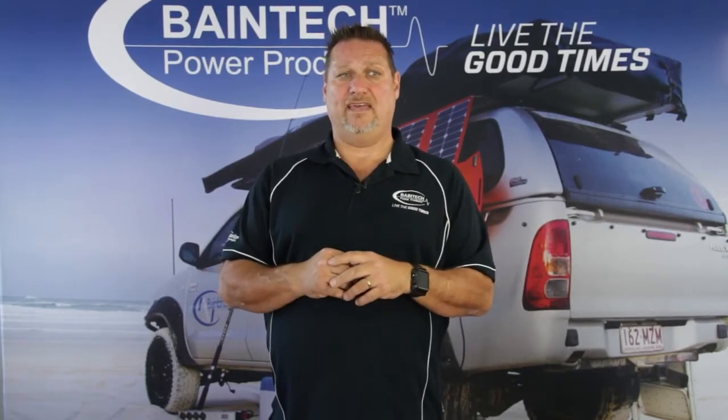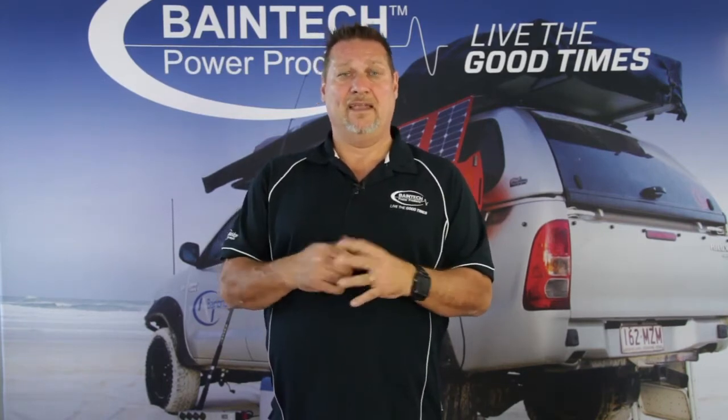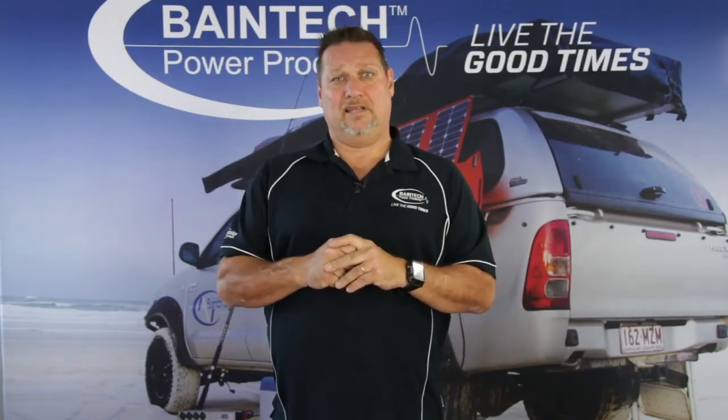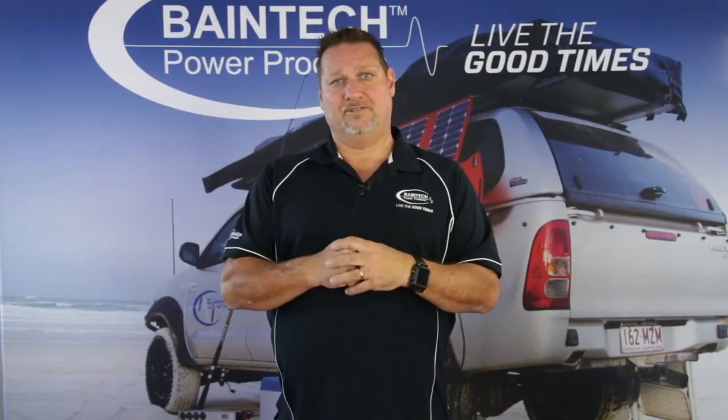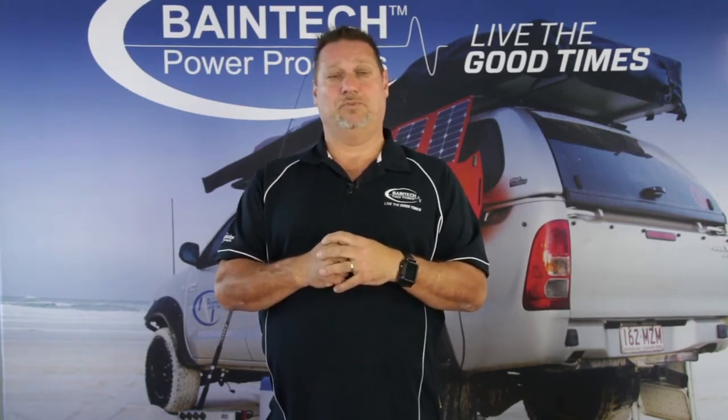The biggest thing overall is heat and how quickly they heat up, and you'll start seeing smoke coming out of your alternator. We actually watched a video on this from one of our suppliers, whose Victron products we distribute, in a boat, showing the dangers of doing that. This guy put in a $3,500 alternator to upgrade to 200 amps for his new lithium battery bank, and within 3 minutes there was smoke pouring out of it.